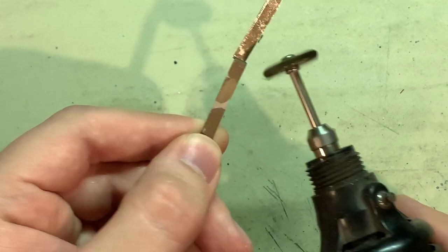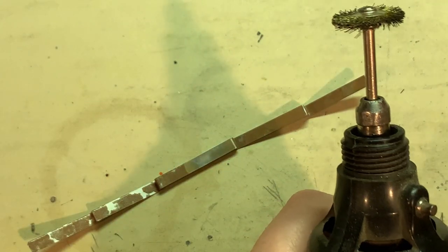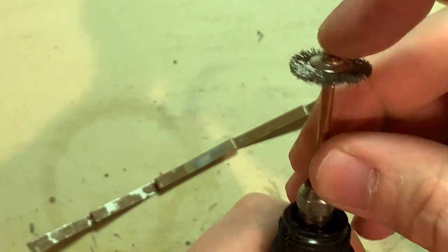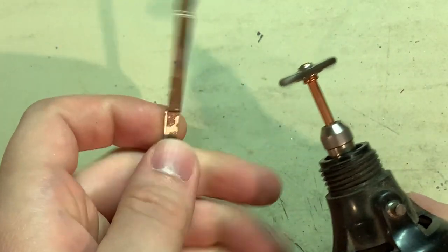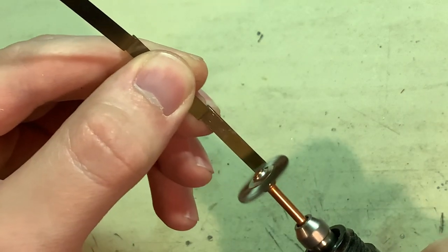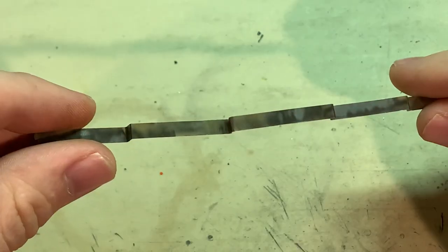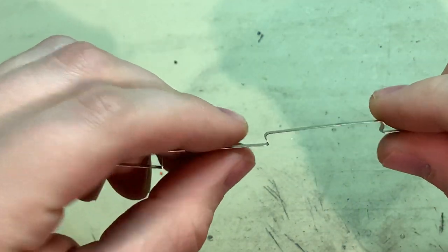Just drill gently and go across it to get the rust off. In this case I think a steel wire wheel will do even more than the brass one. After changing it out — yeah, that's even better. This part here is the most critical since that's where the contact from the truck touches. It's a lot shinier now — may not be a hundred percent uniform, but as long as it's got good electrical contact, that's what really matters.